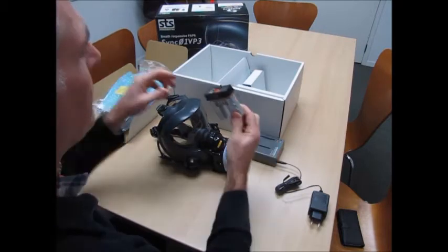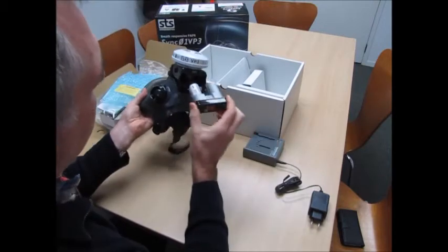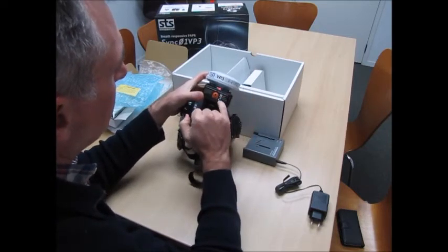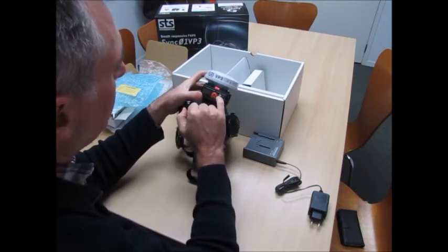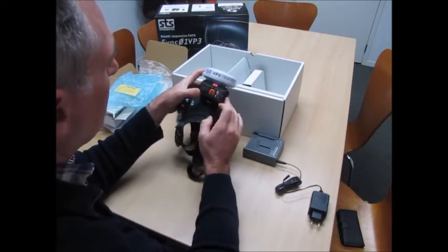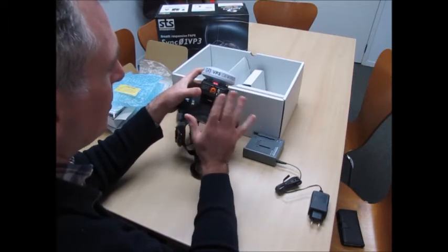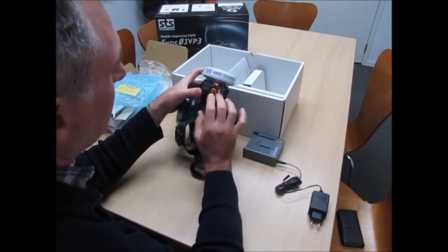Here's our battery — this is what powers it all. That just slides into the bottom. There are battery indicator lights with a key on the bottom that tells you what it's doing. If it's flashing it's not fully charged but still usable. The LED lights last about 30 seconds after you first insert the battery to tell you what state it's in. If you get alternating flashing lights, that means it's going to lock the fan down so you can't use the unit — you need to charge it once both lights are flashing.